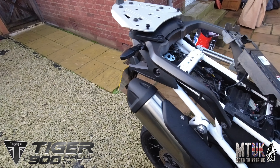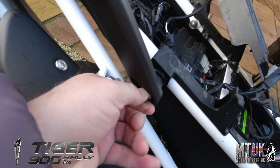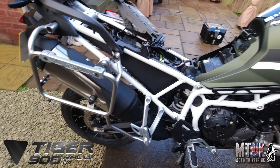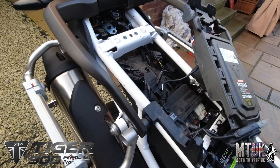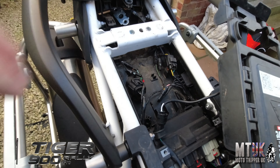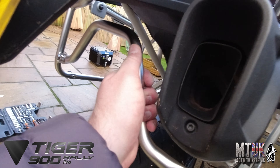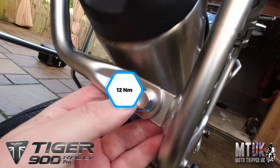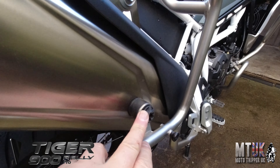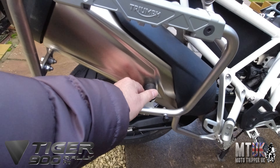I would rather use the new nuts. But you don't use this bolt — you use the new bolts that you get with the pack. Right, that's them all on. I've just put this all back together, but before I do that I need to torque these to the correct settings. As I say, I've got it on my phone and I'll get that in a minute. The final bit to go on is this bar here — it's just two bolts at each side, and they'll all be torqued. And there's a little rubber thing here to stop this bashing against the exhaust. Don't forget to put that on.